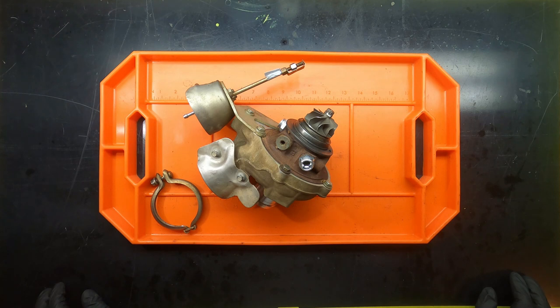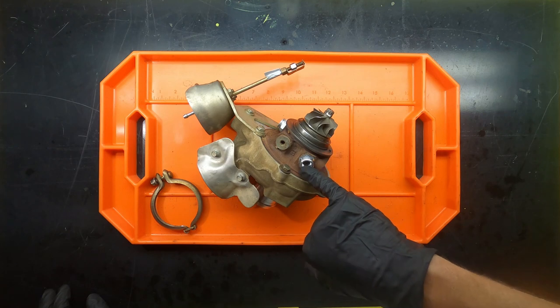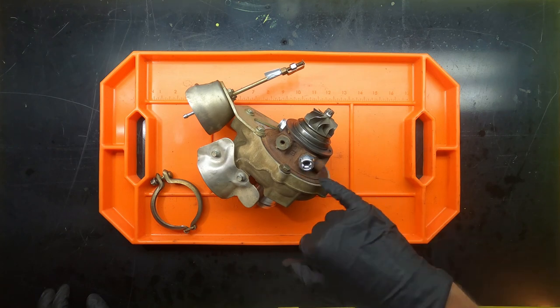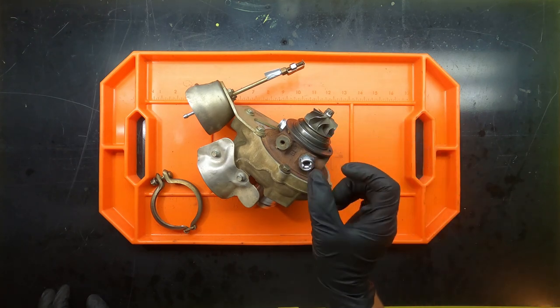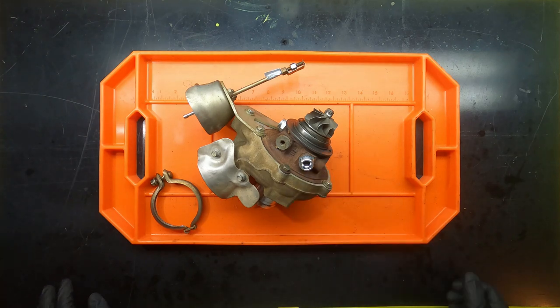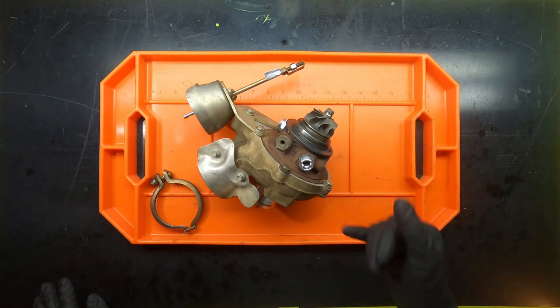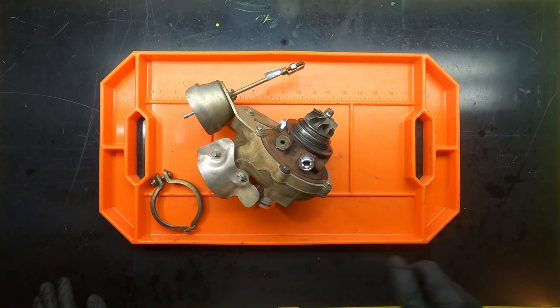Okay, that's about all I've got for now. The last thing that I'm not going to do on video is they do recommend that you take a little bit of grease and install just a little bit of grease inside these fittings, and you leave the clip in, because the way that the line is, you can basically just push it in and it clicks into place, as opposed to putting it in and then inserting the clip when it's really inconvenient. So I'm going to put a little bit of grease in these and then leave the clips in place so that they're ready to just insert and call it a day.